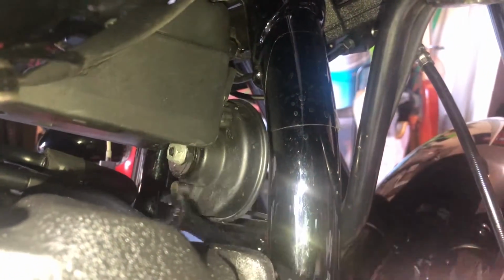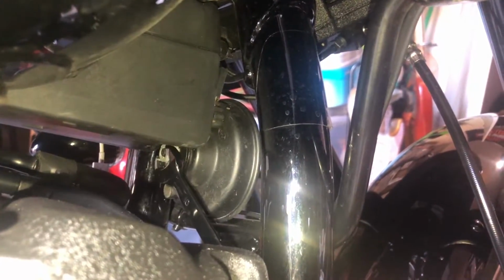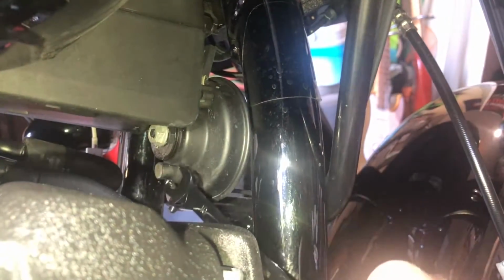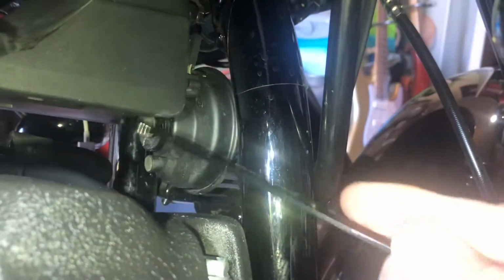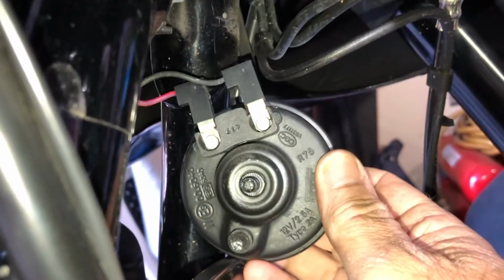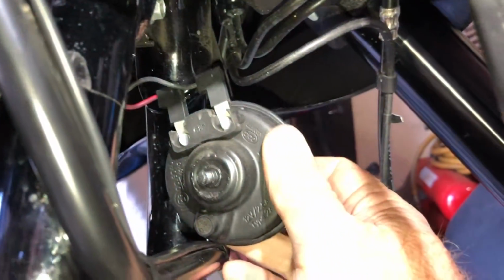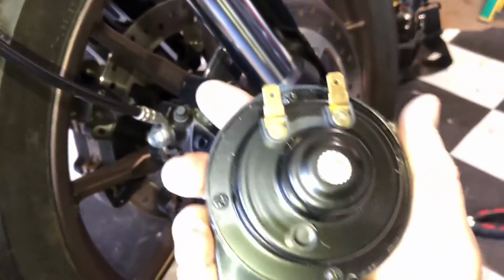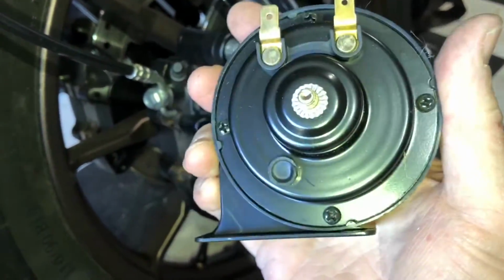I got a long 10 millimeter here that you can just get in there. Get her going. See, you got to inchworm it. Get it loose enough for a finger bang. Almost there. Two connectors, your negative and your positive, right there. We'll take those off with the needle nose pliers, and then we will hook it up to our new horn here. The Wolo loud one.